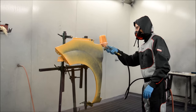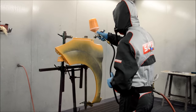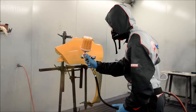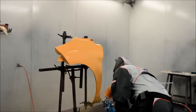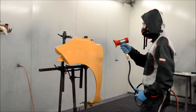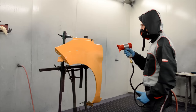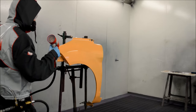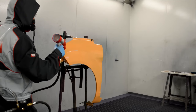On a vehicle you'd only do one edge — the wheel arch — so I'm probably spending a bit too long on this, but I'm making sure it's right. We're using the SATA 4400; this is actually a new gun I'm testing out, so why not put it through its paces with a three-stage pearl. We've applied the full wet coat and now we're drying it. Each layer of base coat must be fully dry before the next — any wet base coat with the number of coats we're applying will cause problems later. I'm using the SATA Dryjet 2 for this.